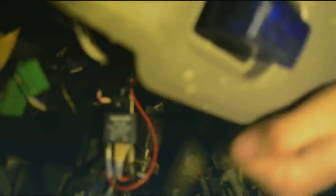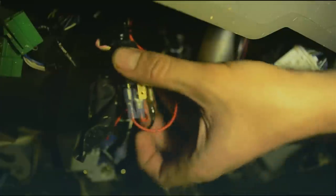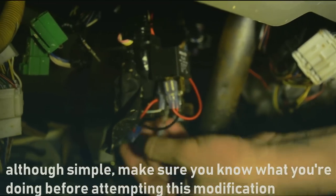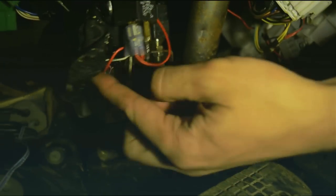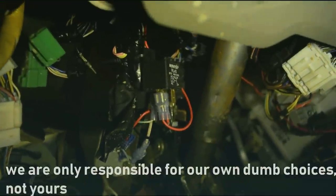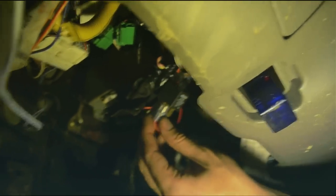All the real magic happens up under the dash. You've got to find the transmission control unit. Here's the relay. The important one is this white and green wire - I've split it at the TCU. Normally it goes from the TCU and connects up through the harness all the way down to the transmission and eventually into that solenoid. I've set this to full manual, wired up differently than some people wire it up, because I've got the VTD in there and this TCU does not know how to control that diff - the logic needed to control it is different.